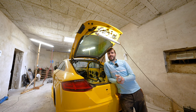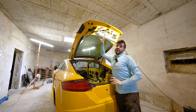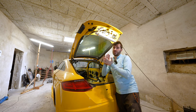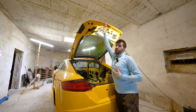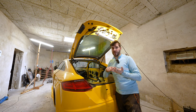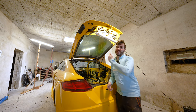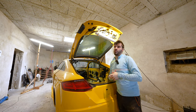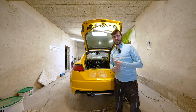There is one more thing you can do to go a step further in preventing water from coming in. I've seen somebody online who uninstalled the whole rear spoiler and then went all around the mating surfaces of the spoiler with the boot lid with a bead of silicone sealer, basically sealing the complete spoiler unit to the boot cover so there is no way water can come in.